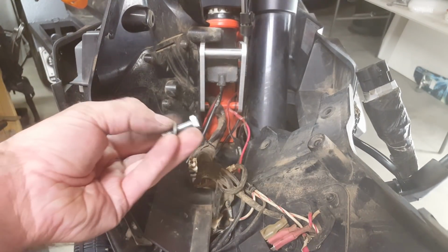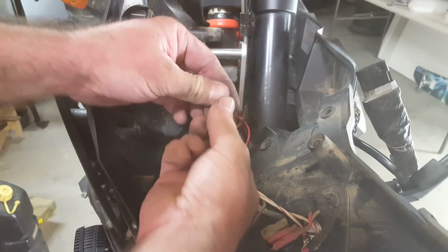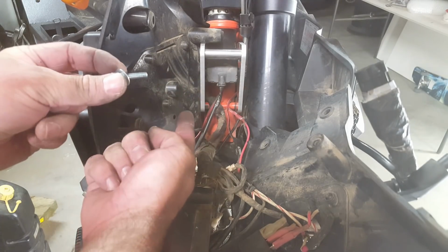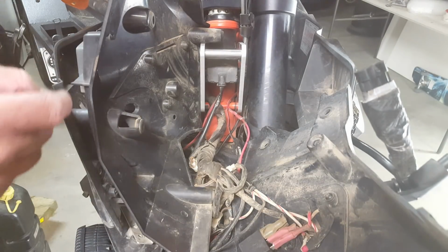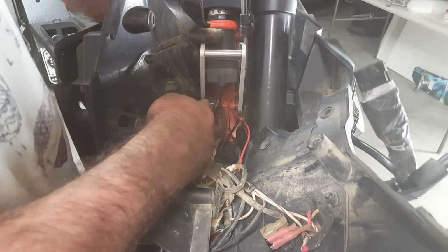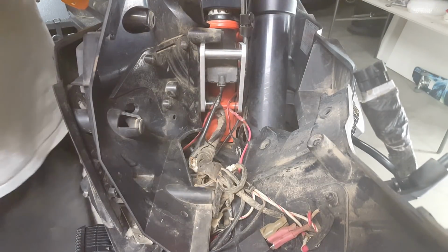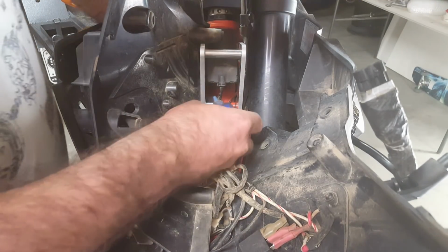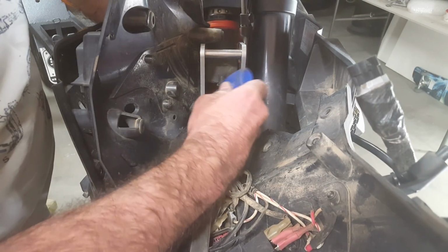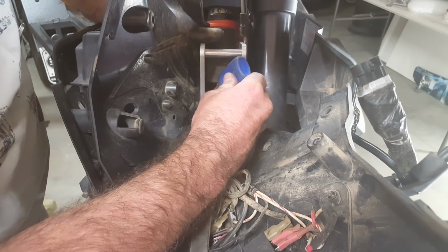Okay, so grab this nut and washer out of your kit. Take the nut off, take one washer off, and put this through the hole that you drilled in the side of your plastic, which you drilled in exactly the right spot. Okay, should come through just like that. Put the washer on. Now, again, put some Loctite on there.